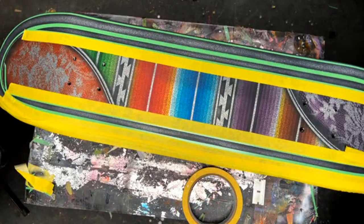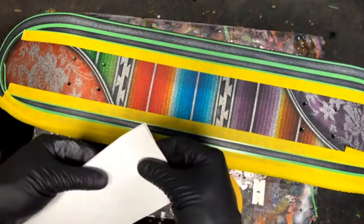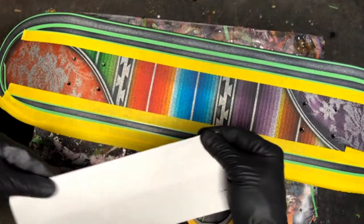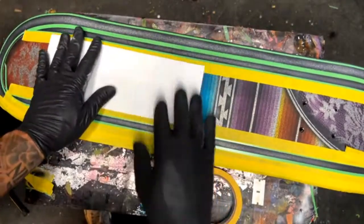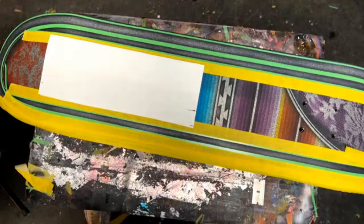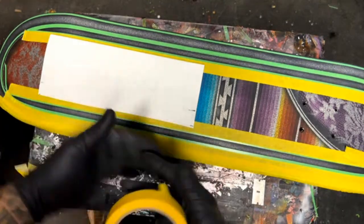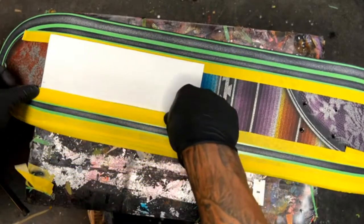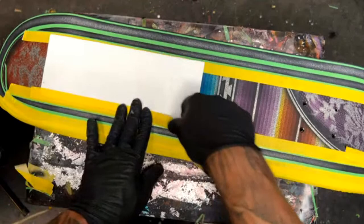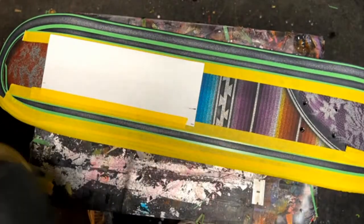What about a base coat before the 2K? That is a good option. Like we were talking about how the clear coats can disturb the candies, you can lay a clear base coat or intercoat clear on top of it, which will further help. But I don't necessarily like doing that, because then you're just adding more thickness of uncatalyzed paint that you don't need. You can do it if you think you might run it. So yeah, that would help protect that.